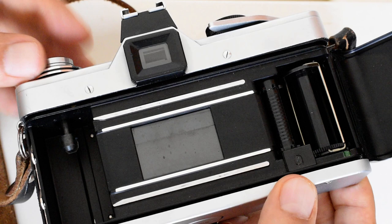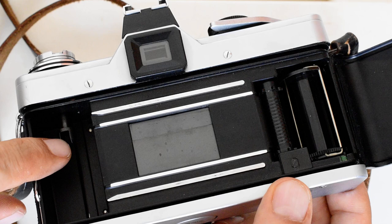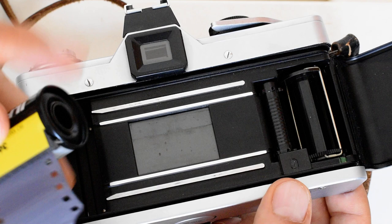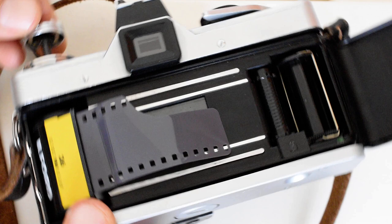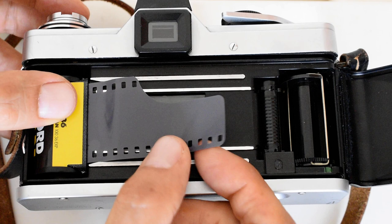Now I've opened the back of the camera. You'll notice that as I pull this up and down, there's a mechanism with a fork here. That is going to mate with an opposing part here on this side of the film cartridge. But in order to insert the film cartridge, I need that up and out of the way. Insert the film cartridge or cassette, and now replace the knob — make sure that it's mated properly.